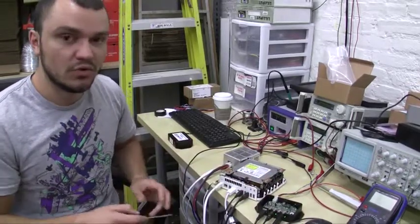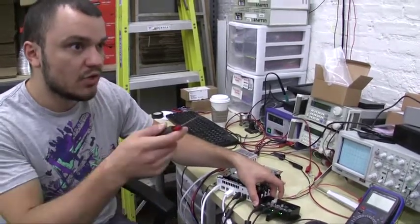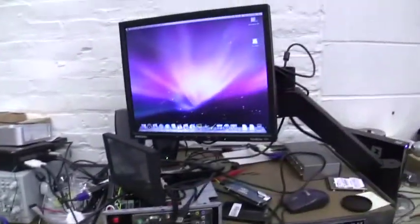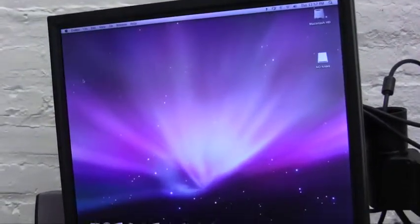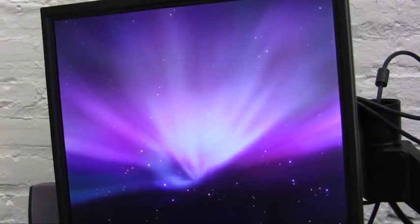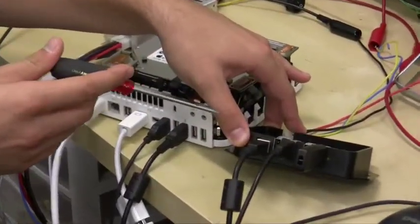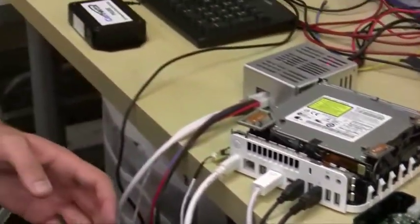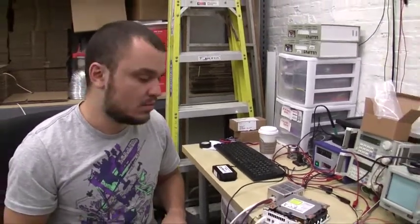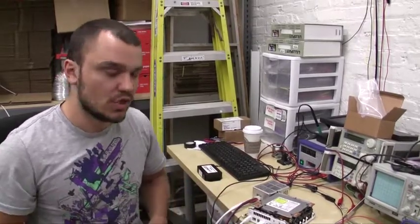You'll just need to restart your hub at some point later down the road. Mac OS X is up and it recognized the keyboard and the thumb stick. Now I'm going to shut down the Mac, and during the shutdown process you'll see the hub also turns off along with the Mac Mini. That means all of your devices shut down when your USB bus shut down, which means they were still enumerated. So if you're going to hibernate, you don't lose enumeration, and when your operating system starts back up it doesn't have to re-enumerate your devices, which would cause a whole bunch of trouble.